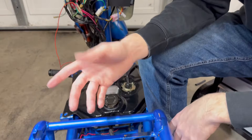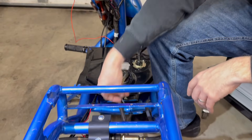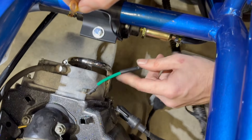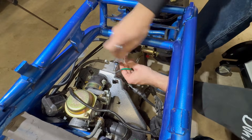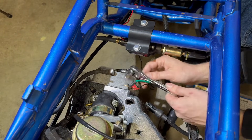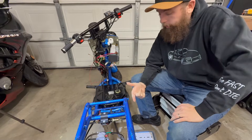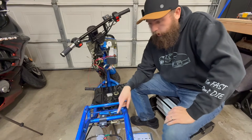You probably wouldn't hear it yet because the ground's not connected. If I connect the ground and you hear the fuel pump, I'm connected to the wrong one. I'm just going to run it off the same ground that our actual chassis harness runs off of right here. Now power is connected, ground is connected. Fuel is coming from the tank — fuel from the tank, going to the carb.